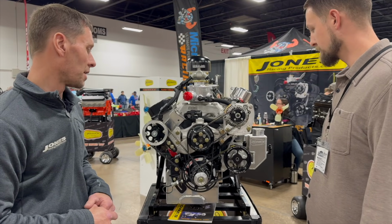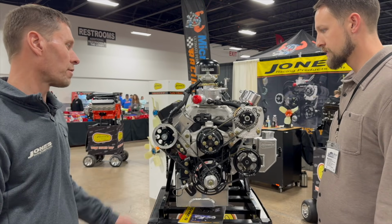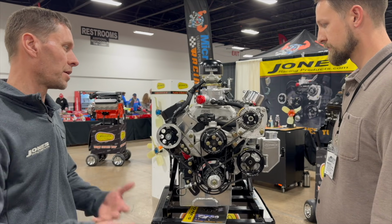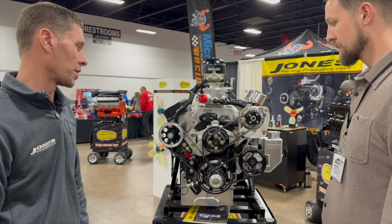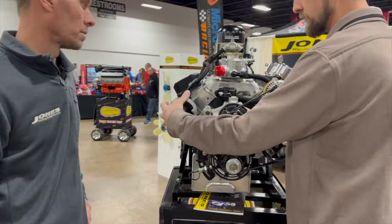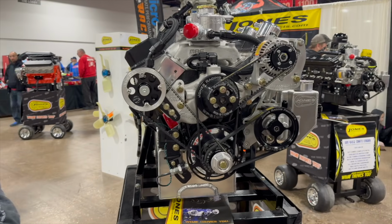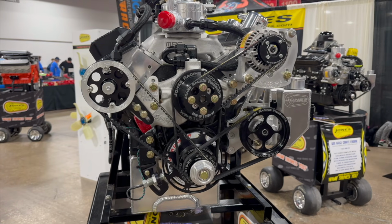And then just one of our belt-driven fuel pumps, like I know you run on some of your big blocks. One of our standard 358 style kits, whether it be dirt legal 358 or Pennsylvania, New Jersey spec, but this is one of our most popular kits. What I like about this pump is it gets it away from the engine, keeps the fuel cool, and consistent fuel pressure.